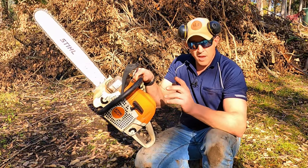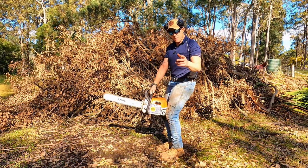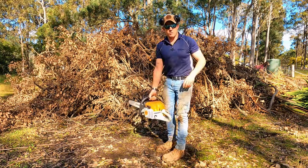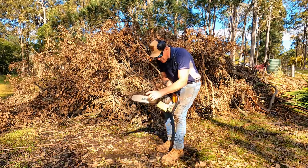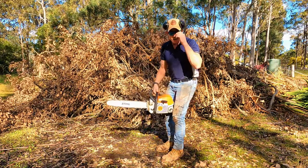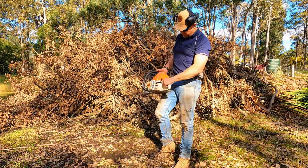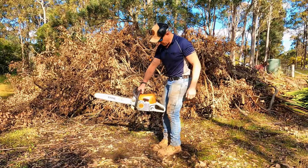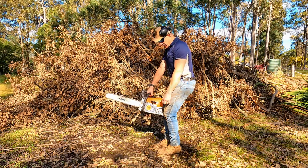Now, I'm gonna show you how to start a warm saw. People tell me I'm crazy for this, but this is in the manual — go and read your manual. This is the best way. Don't be throwing your saw around. You're gonna lose it, it's gonna end up in your foot, the chain's gonna run on. Even if you just get nicked by one of these teeth, if your chain's sharpened, that'll ruin your day. So we're gonna put our saw to the back, to the on position. It should be warm now. We're gonna put the saw between our knees and give it one good sharp pull.